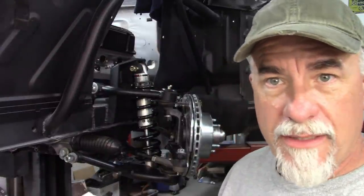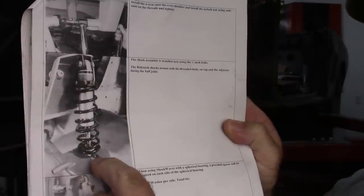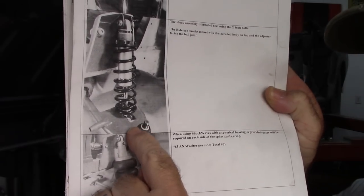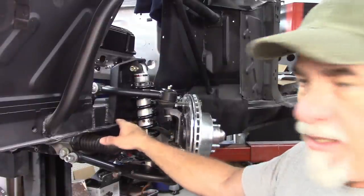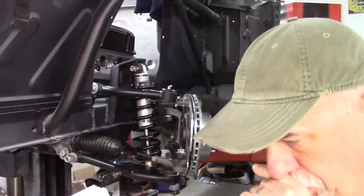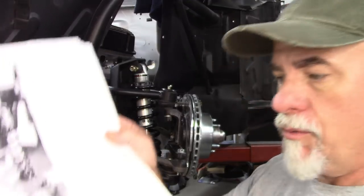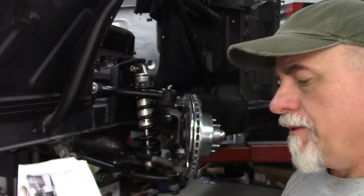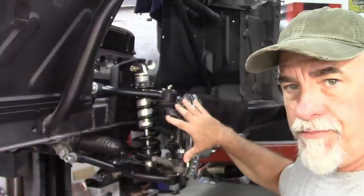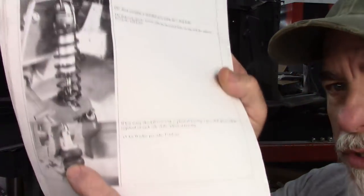Something else I want to point out before I take this apart: the shocks on this car are installed upside down. The adjusting nut is at the top and the little control valve is at the bottom near the lower control arm. It may look odd because you can see 'RideTech' printed upside down. Also, the owner is going with the ShockWave-type shock absorber — the one down here with the airbag built into it. So for now I'm just doing the spindle swap, and later on hopefully we can put the airbag ShockWave setup in there.